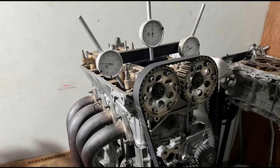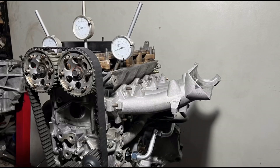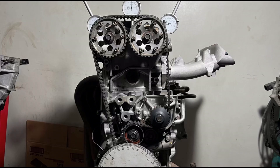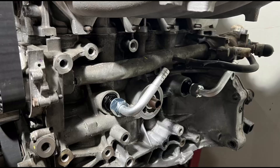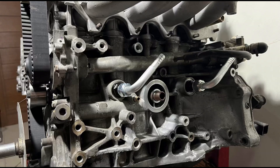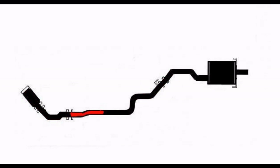On the last episode, we were talking about increasing or improving efficiency. And even before that, we were degreeing the GSR cams because it's going to be a limited cam for this B20 VTEC. We're going to talk about all the valuable ways we can increase efficiency — by way of induction, exhaust, and ultimately increasing volumetric efficiency above 100%.